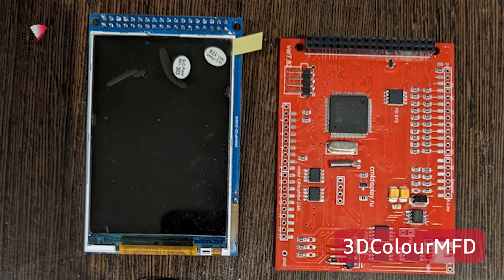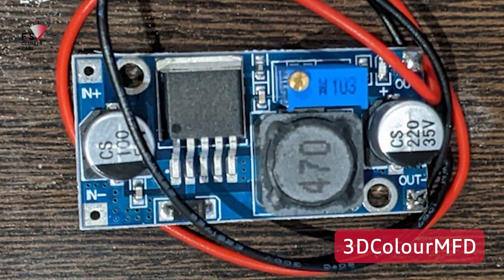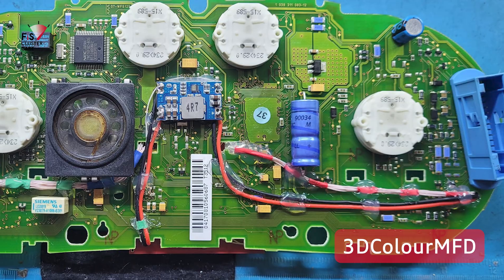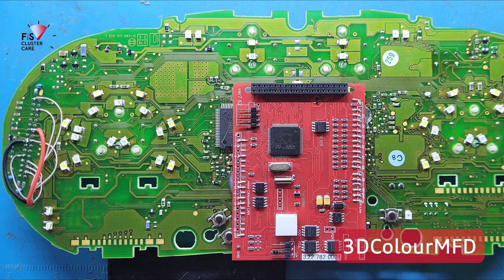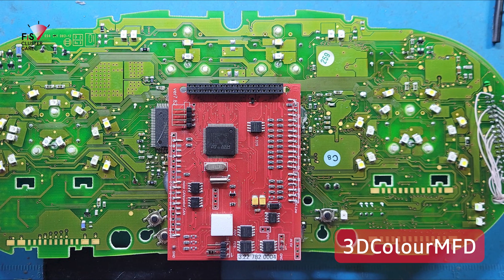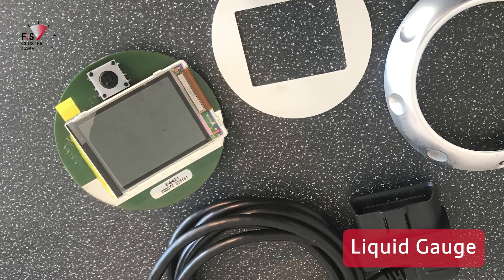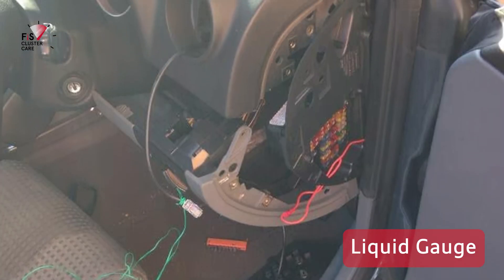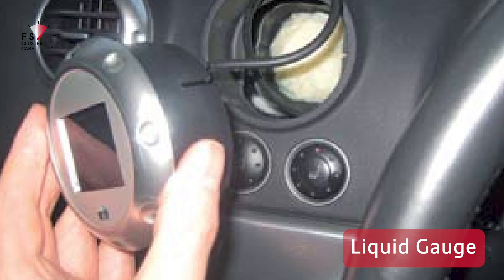With 3D Color MFD it is quite similar to Color MFA in that you'll have to get your instrument cluster out to do the retrofit. The main difference is the annoying step of having to set up a power supply board which also needs to be mounted elsewhere on the cluster before it can power up. There's also high customizability of the firmware but the PC interface is a little fiddly and confusing. Again, lots of effort but a high reward. Finally, Liquid Gauge goes back to the simple life — it just plugs into the OBD port and requires an ignition feed, then you mount the screen into your vents and tidy up the wiring.